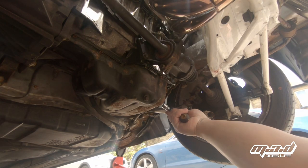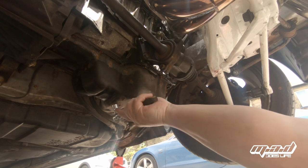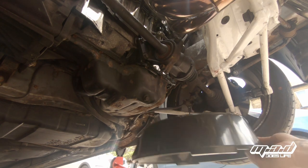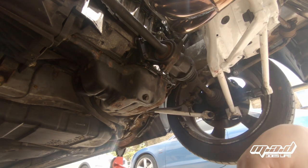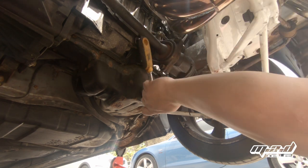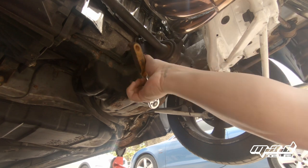As you can see, the old sump is a bit rusty — actually quite a lot rusty. So we're going to drain the oil, swap that sump out, put a brand new one on, and then put new oil in. Let's get the sump plug off.